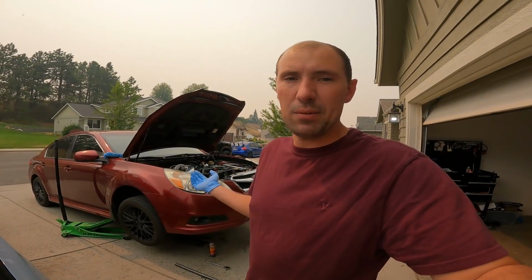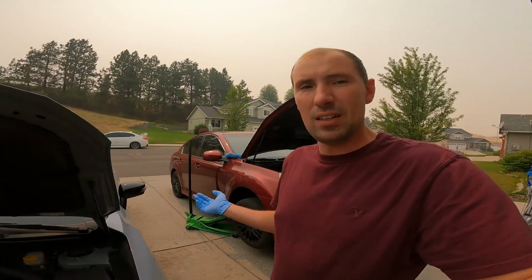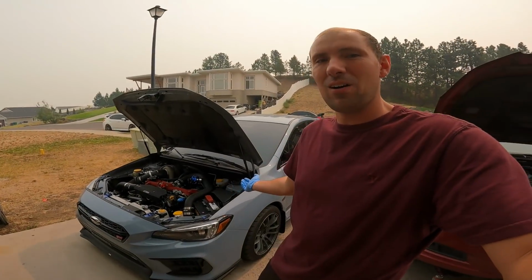But with that information, what I'm getting at is this thing didn't take as much timing as I would have really liked it to on pump gas. But she just took all the timing, because we got those pump gas fire specs in that motor. This thing is a beast. I could have pushed it way more on pump gas, guys. It made a 484 or 482 on pump gas at 25 pounds. We could have made her party.